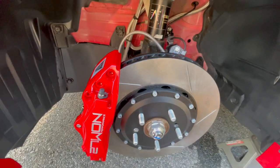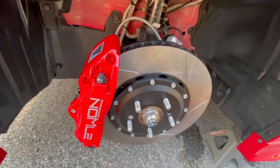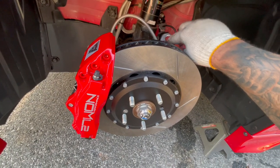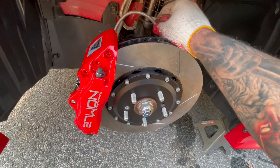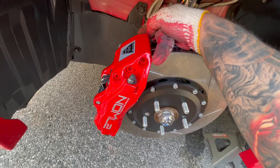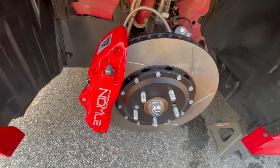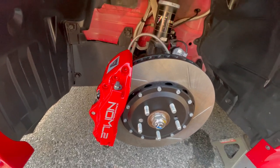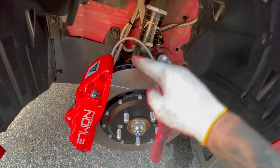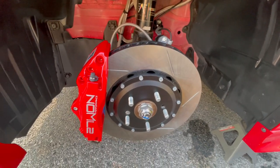That's pretty much it guys. Once you take off the original calipers using the two 17mm bolts, the whole thing comes off. Take off the 12mm bolt first — sorry I keep forgetting to say that — then get the stock brake lines loose. You can take the line off the back of the caliper first and let it drip, it's up to you. As long as everything goes back on correctly, that's what matters. I hope this guide helps you install your big brake kit.